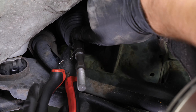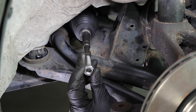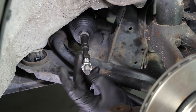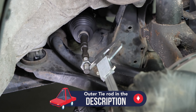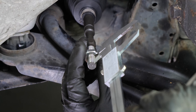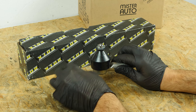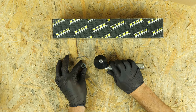Don't forget to slide them under the vehicle. You can now see the outer tie rod end. These elements can often get jammed, so use a penetrating oil to facilitate the operation. Using an adjustable spanner, release the holding nut on the tie rod end. It is there to stop any form of rotation of the two pieces towards each other, as this could have an impact on the geometric settings of your vehicle.